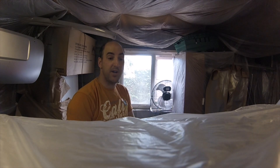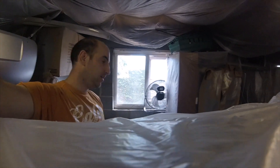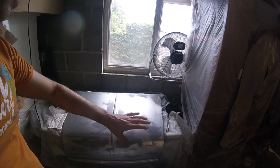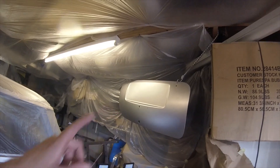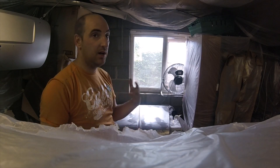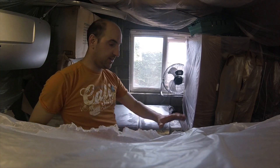Slight issue here - need a do-over on the bonnet because it's munched it a bit and there were a few other marks on there, so we're going to do the bonnet again. It's going to need quite a few coats because we've gone through in some places. Just been over it with the panel wipe. Got this side of the car protected. We're going to be spraying in this direction with the extraction right there, hopefully avoiding any overspray coming back onto the car.